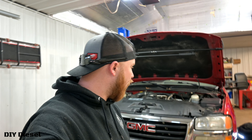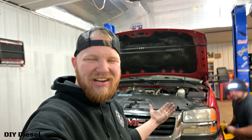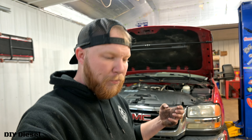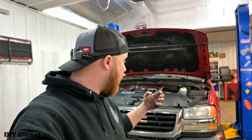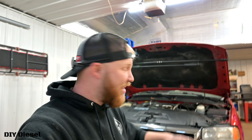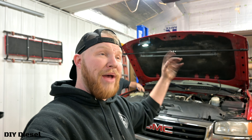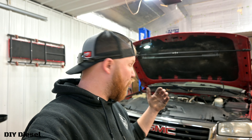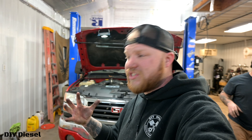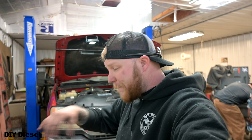Remember: that water pump back bolt on the bottom side — you can get at it from underneath. I haven't found anywhere else who even mentions it. A lot of people just skip it. You've got to remove that lower radiator hose from the water pump anyway to drain your cooling, so remove that, drain any coolant left because that's the lowest point, and then you can get at that lower water pump backside nut easier with a wrench. Stay tuned for the follow-up video. Please like and subscribe — I hope you enjoyed it and we'll see you in the next video.